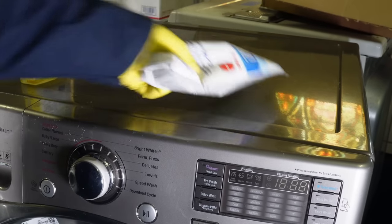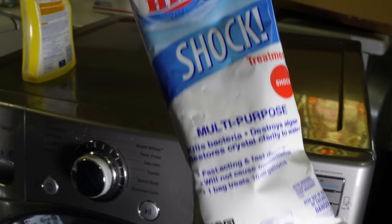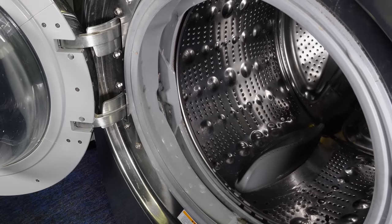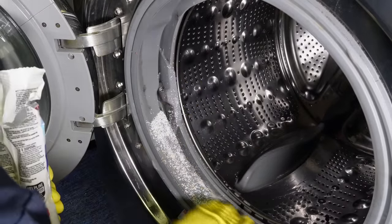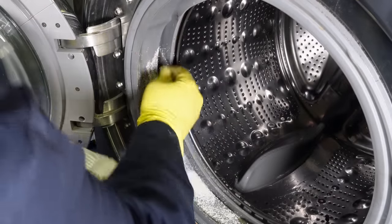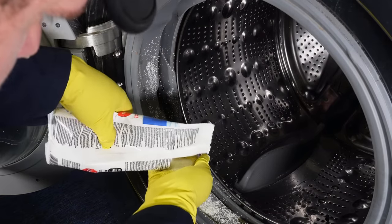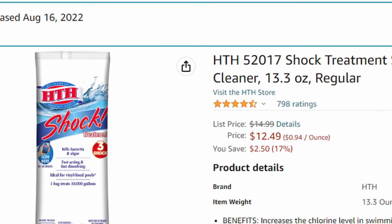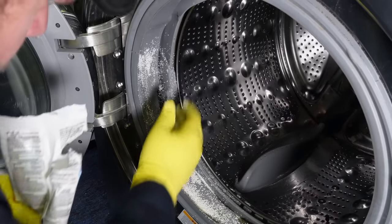With the door soaked, let's get to the secret item we mentioned at the beginning of the video — we want to use it to get the mold to rip off. I've tried bleach and other things a hundred different times, which can lighten the mold and the door seal, but it never really eliminates it. The item we're using today that's special is called Pool Shock. This bag is designed to treat a 10,000-gallon pool with chlorine, killing anything organic in the process, but instead we're using a fraction of it to kill the mold in a 20-gallon washing machine. This is the only product I couldn't get locally and instead bought off Amazon — a link will be in the description, but you could possibly find it locally depending on your location and availability of a pool supply store.